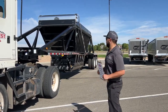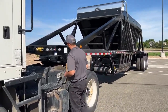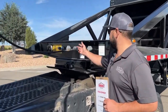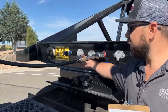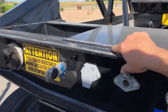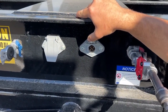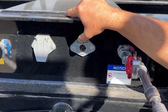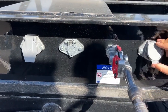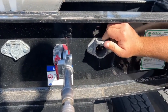We'll start here in the front on this 2023 belly dump. Got a couple features along with the glad hands and your standard 7-way. You also have an auxiliary 6-way. That's so you can run your in-cab switches to dump the trailer, and it also functions the airbags for an airbag dump. Over here is just your tarp plug — your two-way horizontal tarp plug.